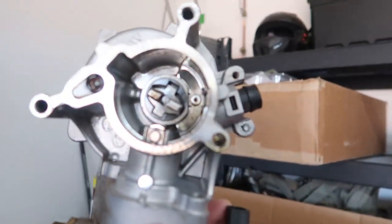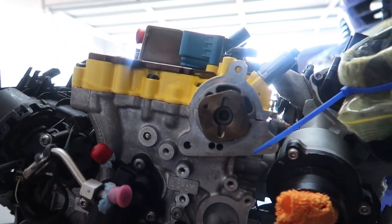I asked gen3jeta how to install the HPFP. I was trying to put it on — there's a roller in there with a spring and you'd have to compress that and match up the teeth into the cam. He said it's hard to do it that way, and to just take the two bolts off the top, pull it off, install the bottom, install the top back on — should be pretty simple. So I'm going to clean it up, put tape on the surface where the gasket goes, take it apart, put it in, and grab the crank pulley.